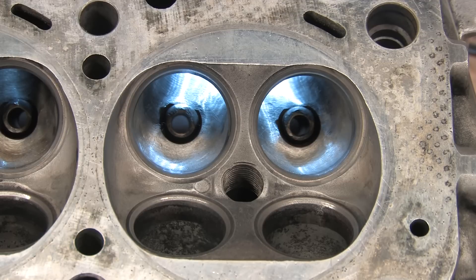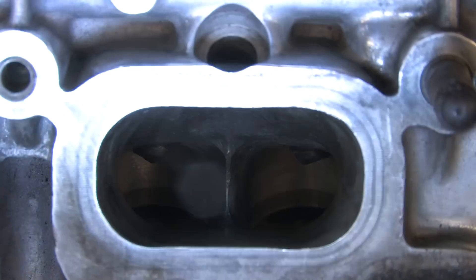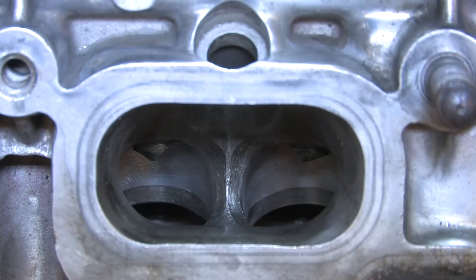You'll need to blend the roof into the bowls. There's also a little ramp in front of the valve guide, but the area next to the valve guides is what you want to cut a little bit wider — just grind away the rough cast close to the valve guides. Try to leave the back of the valve guide shrouded because it reduces drag. You absolutely must maintain a smooth gradual curve all the way around the bowl and make each one exactly the same. It takes a lot of time — it takes more patience than anything else. Go play in your zen garden for a while before you start.